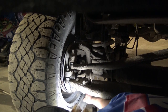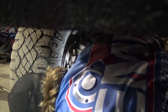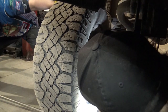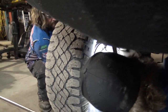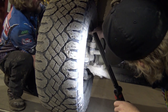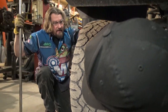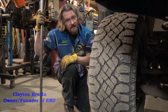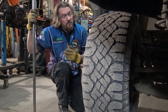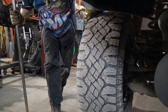Ready? Yeah. This one's not so bad. It's hard, the truck's moving. Yeah. But there's maybe 15 on that side. So I'm gonna take it from top to bottom. And that is all in the upper. The lower is actually kind of hidden because of the plastic inserts that are inside them. Yeah. It's hard to see it in motion like this, but when you put the weight of the truck on it, it'll actually move more than you actually see. Yeah. Which is part of what creates that weird cupping in the tires in the front.